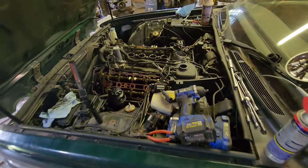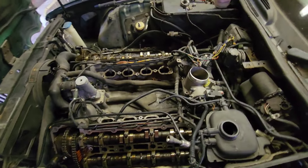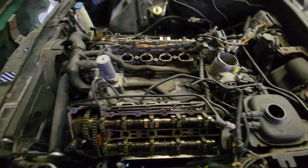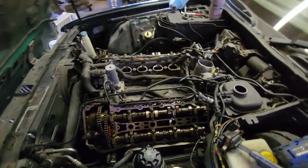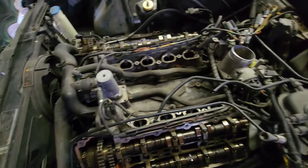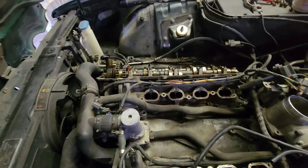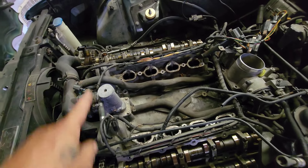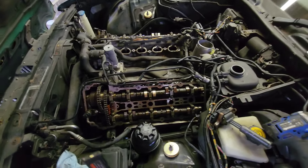This vehicle right here was missing some pieces when I got it. It was sorta diagnosed with a timing chain tensioner gone bad. I've pulled the valve covers off myself and confirmed the timing chain tensioner on that side has gone bad.